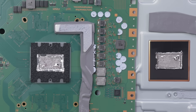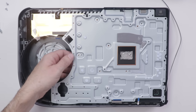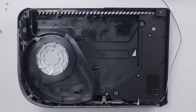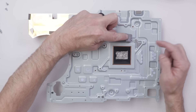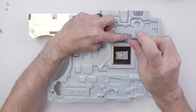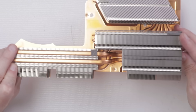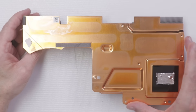Let's remove the screws in this bottom plate so we can take a look at the power supply. With all those screws removed, we pull out this bottom plate and the heat sink. To separate the metal plate from the heat sink, Sony has hidden a screw right under there — so you have to remove that screw first. And here is the massive heat sink in the PS5: all the fins and heat pipes, and this is just one massive hunk of copper.